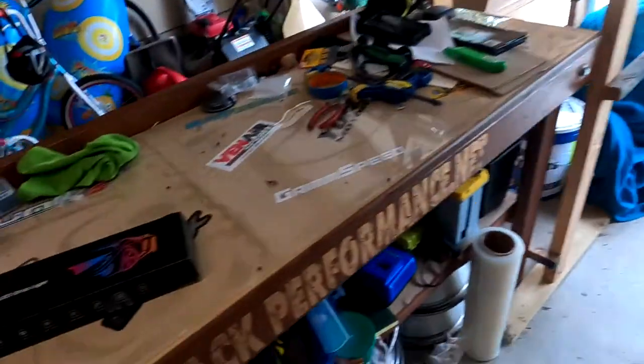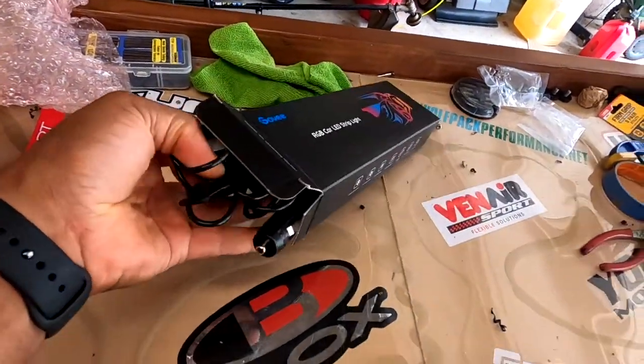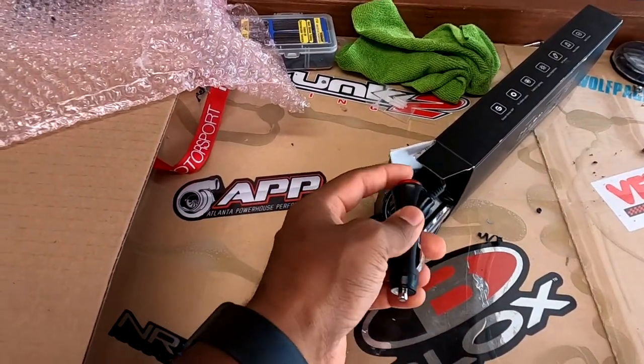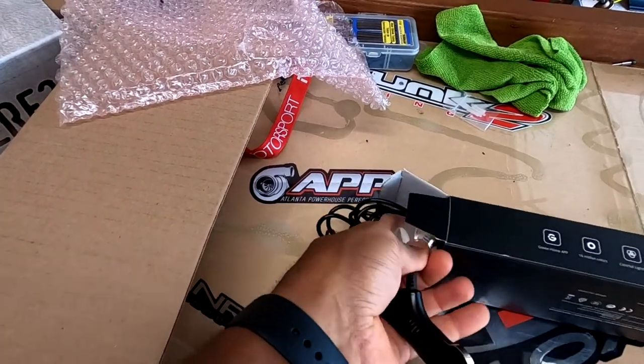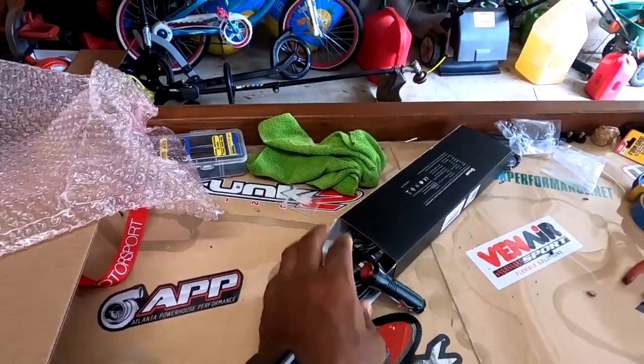The next portion of this project: I'm going to try to add some illumination lighting. I got this kit — it's a cigarette lighter plug-in kit, which is horrible if you actually use it that way. I would not recommend it — that could be a little trashy. There's an on/off button. What I'm going to do is take this out, shave it back, use the wiring only, get rid of the plug, and tap into the lighter section. I'll run this in behind the dash to accent the floorboard and possibly under the seats.